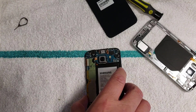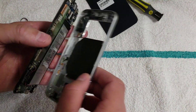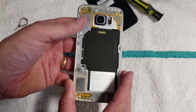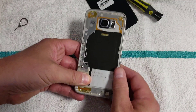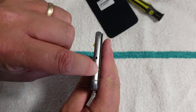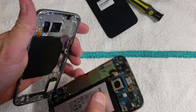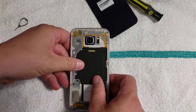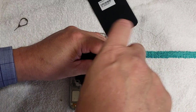Normally at this point I would power it up, but I'm not going to. If you were doing this for the first time, I'd suggest you put the mid-frame chassis on in your hand, power it up, and just make sure everything works. But I'm pretty confident it's all going to work. You start at the bottom when putting the frame on, because if you try to start at the top you'll find there's a bump you can't get over. Put the unit on from the bottom to the top. The thing that's really important is to make sure it's lying flat — if it's not, there's something wrong and you need to deal with it. You heard that clip in — that's very nice.